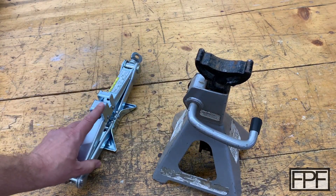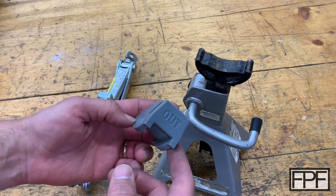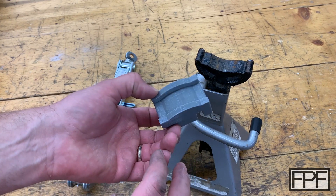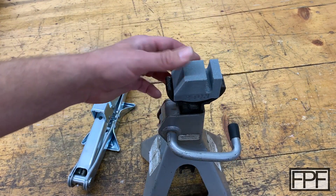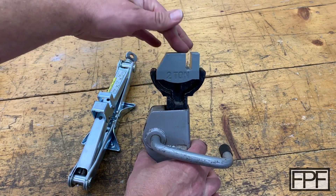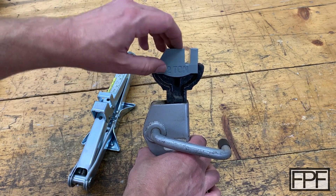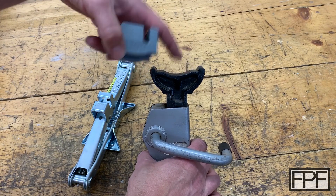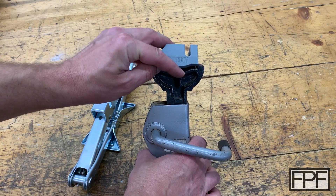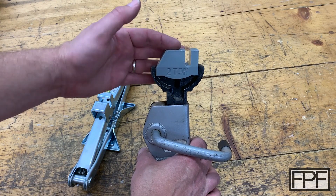What I came up with was a piece of TPU that emulates the design of the factory jack. I marked the side that faces out towards the vehicle, and marked it twice to denote that the curve and skirt fits perfectly over my two-ton jack stand. All the two-ton jack stands I've had have really the same casting — it's like somebody designed a jack stand 20 years ago and every single one's been built the same way. Even my larger jack stands look like my two-ton ones just scaled up. You can see this fits on the stand: we've got that same notch to align it on the vehicle, and that skirt keeps it aligned on the jack stand so it can't slide left or right. It's pretty much locked in position.